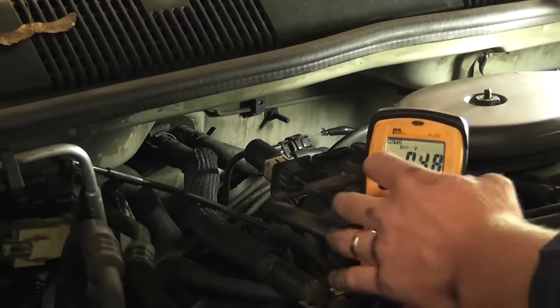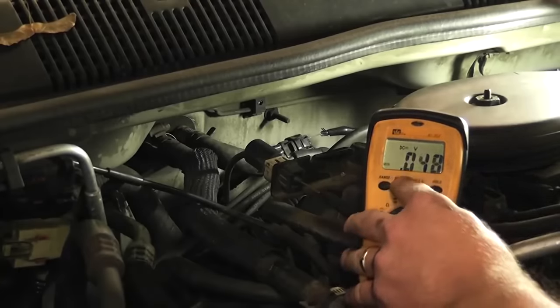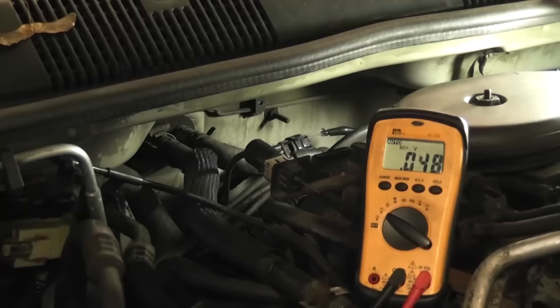What you can try to do, depending on the meter you're using, is use a min-max scale to try to catch that. So I saw a maximum of 500 and a minimum of 0.048 — that is certainly not catching the zero to five volt square wave. We're looking at an average, and my meter's min-max scale is not even fast enough to pick it up. So what we can do in a situation like that, when you're dealing with signals like this that are on-off square waves, if you want to see the full amplitude of the square wave, bump the key. What we'll do is get those hall effect windows — the shutters — in different positions, and we should be able to catch this in a high position and a low position. Go ahead and bump the key.